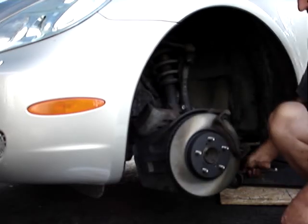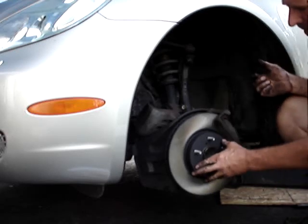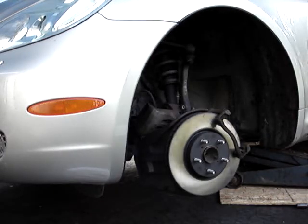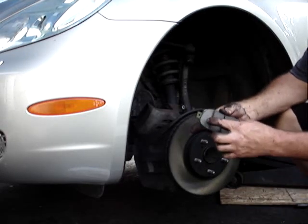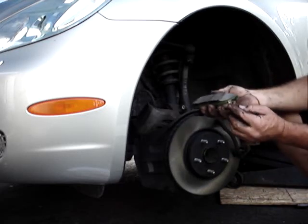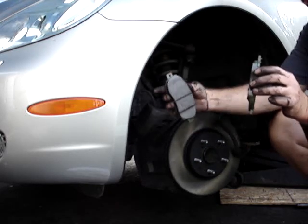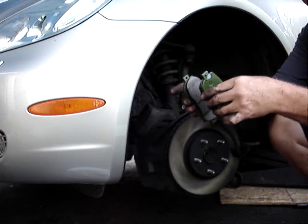Just tight, give it one little extra pull. Make sure there's no extra grease stuck on the rotor. Now find my new pad set — this is where we'll see the taper. The taper on the front will fit on the back side. The sounder should be on the back side. The one without the sounder for the brake pad wear goes on the outside. They have to be matched — this one will be here, this one will be on the outside. The two chamfers are both on the bottom and the pads are facing the correct direction.